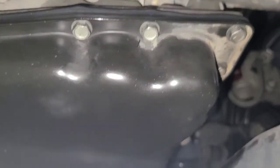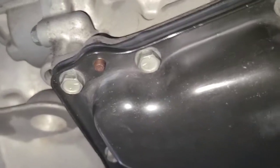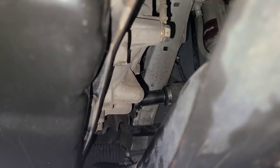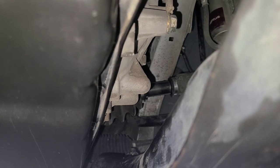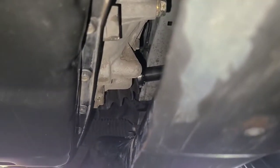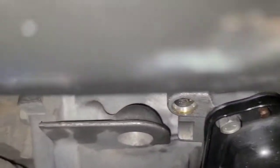There's the housing for the cooler return line - everything looks good there, no leaks. I went around three times tightening those bolts - just went all the way around in a circle, came back, went around again, and then checked them just to be sure they were all nice and tight. About nine foot pounds of torque on them. Everything's good. I also replaced the hub seal on the driver's side there on that axle - pretty easy to do. I'd recommend when you do it, get a kit to put in the seals. It was about thirty dollars. That way you can hammer the seal in and set it properly instead of using a piece of wood or something like that. Got it in, no leaks, seal's nice and tight, and everything else looks good.